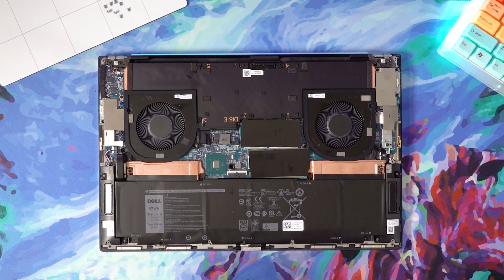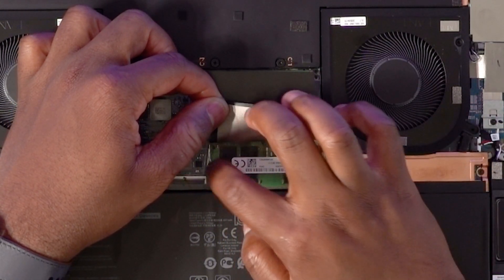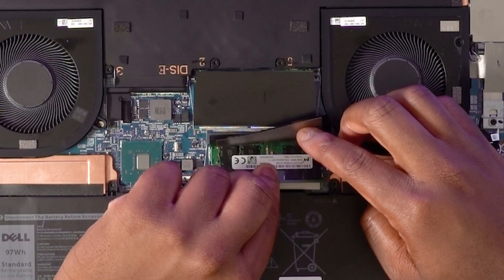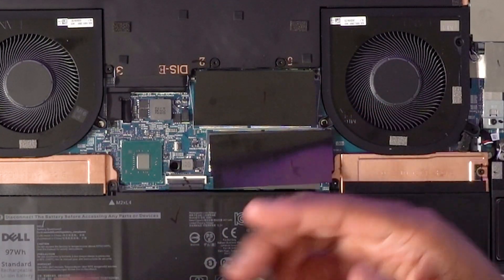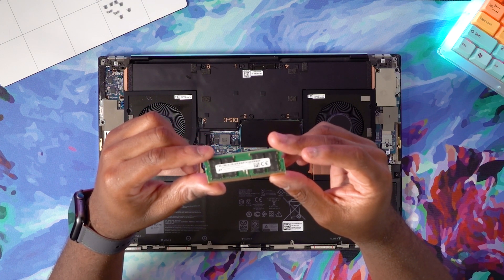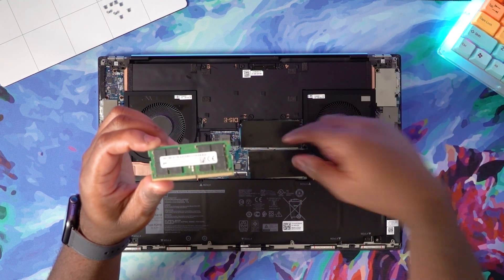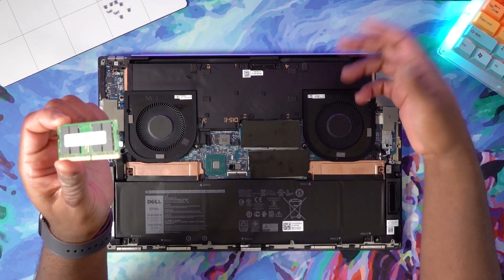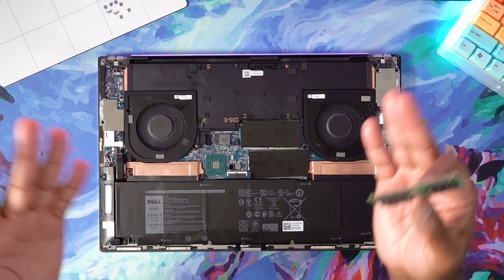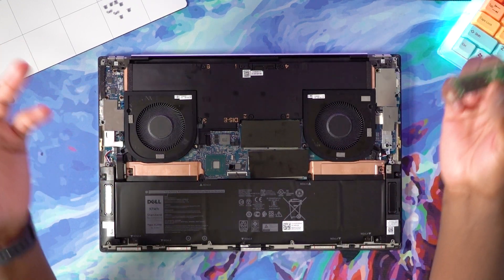So first, how do you take out the RAM? If you want to take out the old RAM, you just pull these little tabs on the side, and then your RAM is going to lift up. After it lifts up, you just pull it very gently. So now we've got our old RAM out. If you go with the max spec, the maximum supported RAM in this laptop is 32GB per DIMM, so you can have a max of 64GB total. I'll leave links to some recommended RAM replacements in the description, depending on if you want 16GB, 32GB, or even 64GB, and save a lot of money from upgrading straight from Dell.